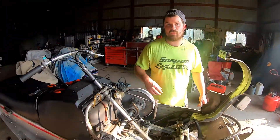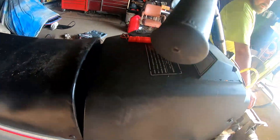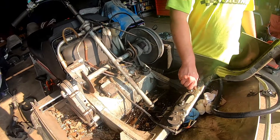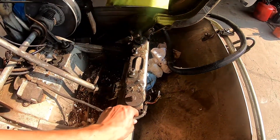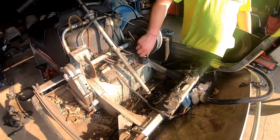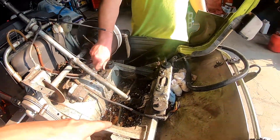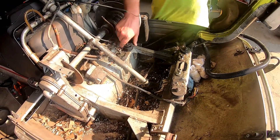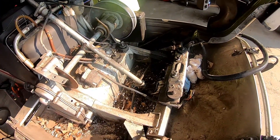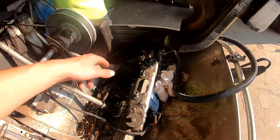Next is to get the dog house off. I want this thing bare tunnel. The motor was out in about three minutes if we wanted. Yamaha is weird how they run their electronics — they run them underneath the motor. It kind of makes for a lot of intermittent problems sometimes, especially if you had some connections that weren't so good. It's 17mm bolts — 17, 17, 17s, a 10 and a 12 — that's about everything on a Yamaha if it's OEM. Needle nose for the oil cable too.